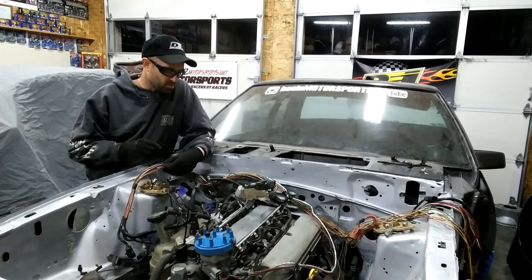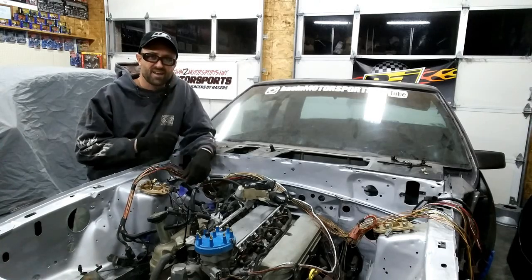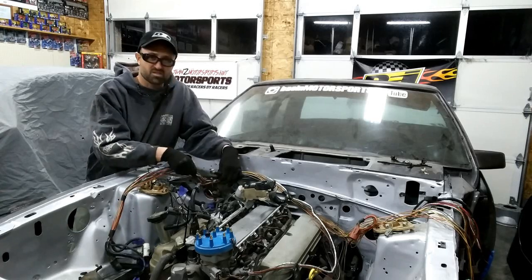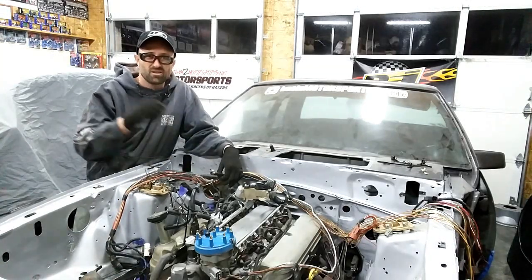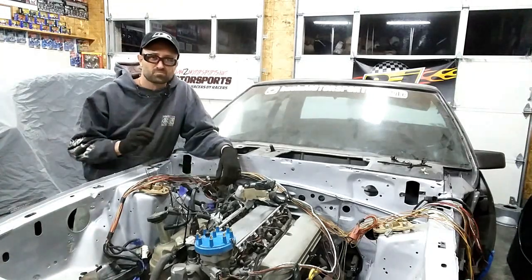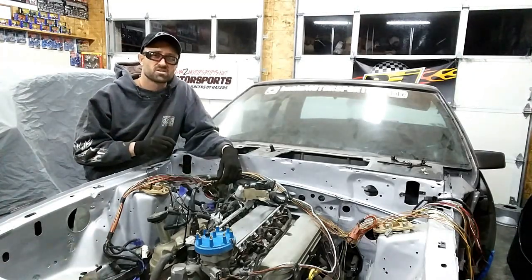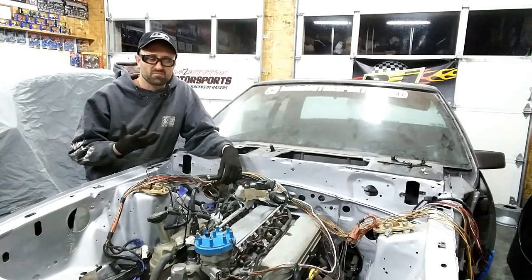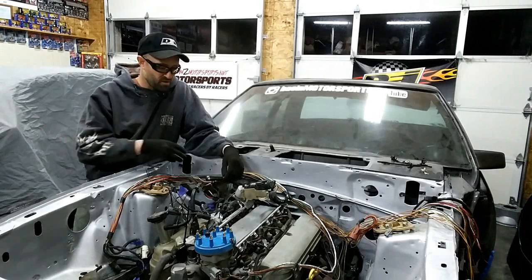What I plan to do long term is, for anything that has to come in the engine bay from the back, I'll re-pin the ECU — basically take the pins out and rerun the wires, because these things are like a big snake mess. I'll rerun the wires one by one so I won't have to worry about getting mixed up.